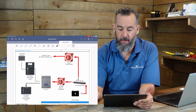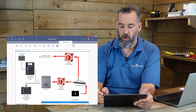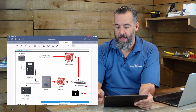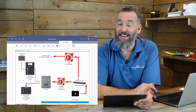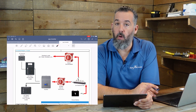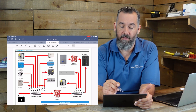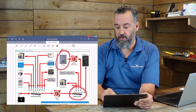If we look at the diagram for inverter-only versus inverter-charger, you can see there's an inverter service disconnect connected to the unswitched distribution. So when you've got an inverter-charger, you want to connect it to the unswitched distribution, and when you have an inverter only, you can connect it to the switched distribution.